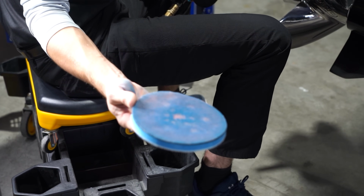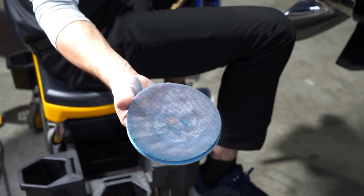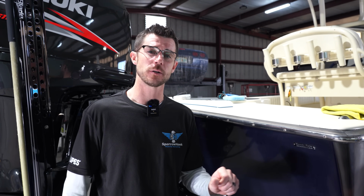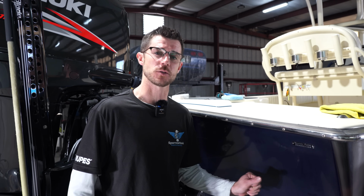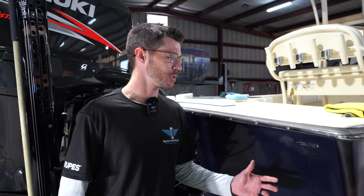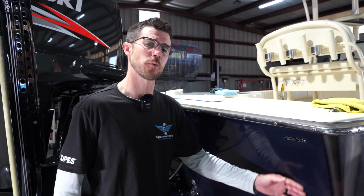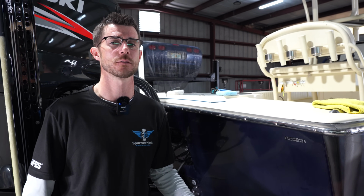So we're going to use a pneumatic tool sander with 1,000 with a foam interface. That foam interface gives us a little bit of play and less pressure. We naturally want to put a lot of pressure on the surface for whatever reason. So that just gives us a little bit of play to where we can put some pressure, but we're not compromising any of the sanding process.